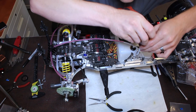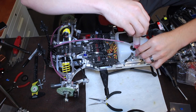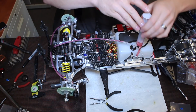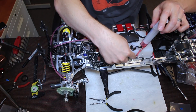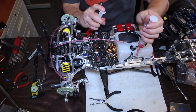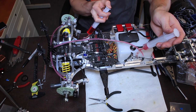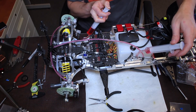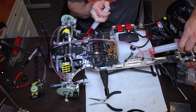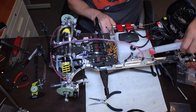Now we're going to open the master cylinder. With one brake caliper closed off and the other still open and connected, we're going to bleed the master cylinder. You can see I've got some brake fluid down there. Just push that syringe to fill that remaining line and watch the empty syringe — watch for the air bubbles to stop, because it has to fill that whole master cylinder with brake fluid. You don't want any bubbles in the brake line, otherwise you won't get strong or consistent brakes.